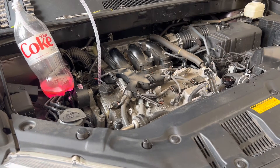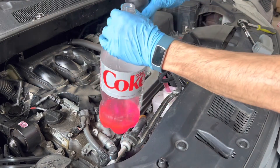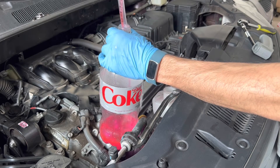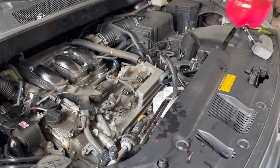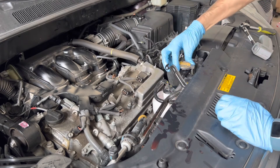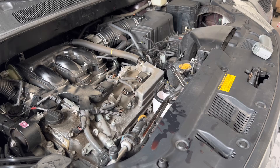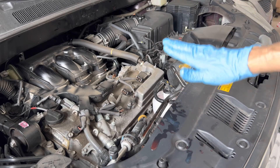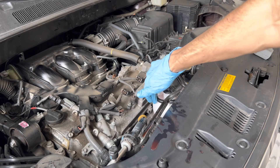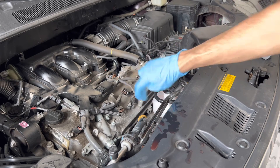I'll turn off the engine now. For the reservoir tank, I'm just using this turkey baster to drain it because I don't want to remove the bolts and then remove it. The job is done. I'll do a test drive, and after that, once the engine cools down, it is going to suck more coolant in from the bottle. Make sure you keep an eye on this bottle for one or two days and after every drive, once the engine is cold, add coolant if required. Thanks for watching.